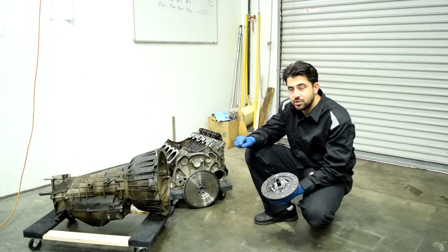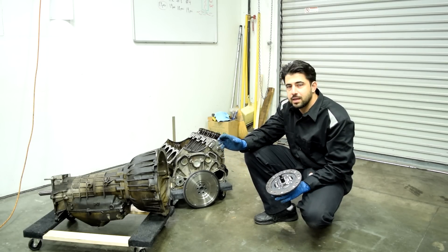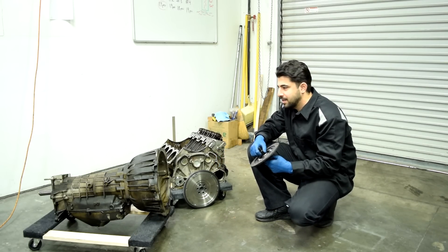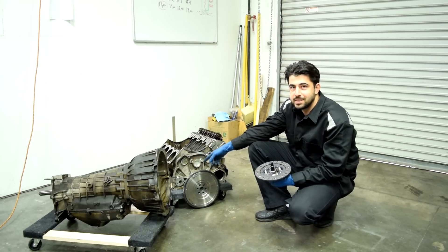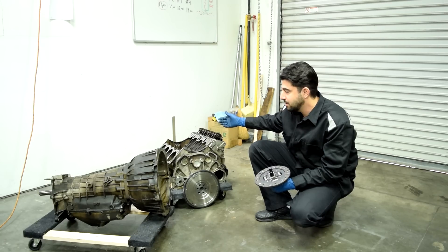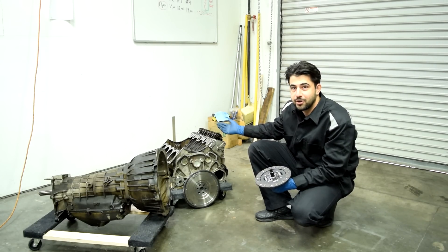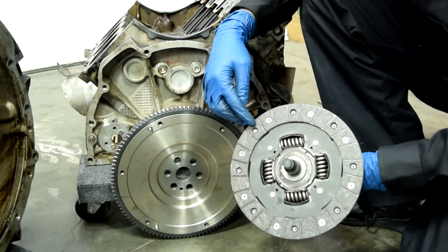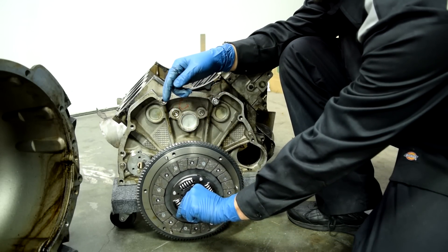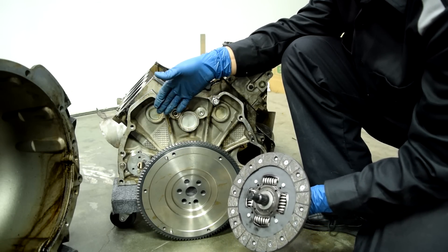Here's how this works. When you put the transmission in gear, apply your emergency parking brake, and remove your foot from the clutch pedal, you're putting a very quick and extreme load through your transmission onto the crankshaft. If your clutch is not slipping, your transmission is going to make your crankshaft slow down quite rapidly or even come close to stopping. When that happens, your crankshaft sensor stops producing a crankshaft signal, your car's computer stops working the fuel injectors, and therefore your car stalls. But if your clutch is slipping, when you put that immediate load on your crankshaft, it's just going to slip on your flywheel against the friction surface — and your engine keeps spinning while you can't get any power from your engine to your transmission.